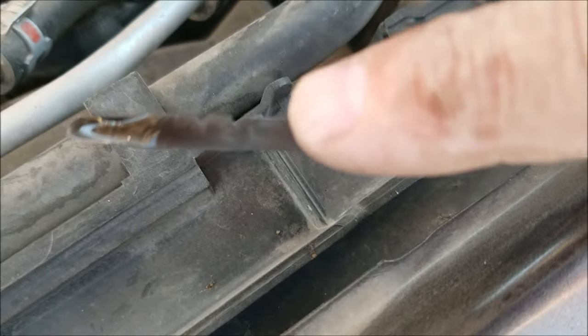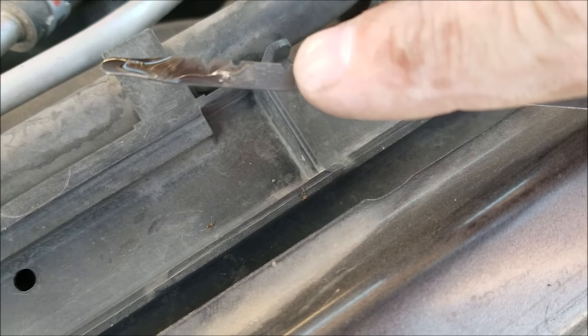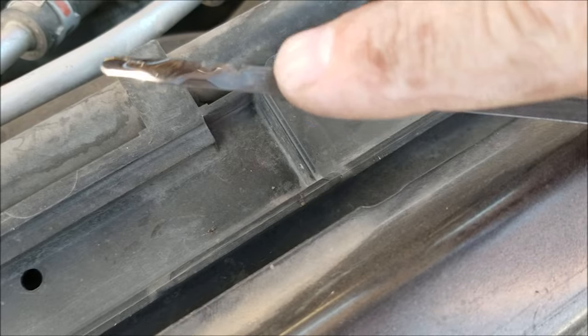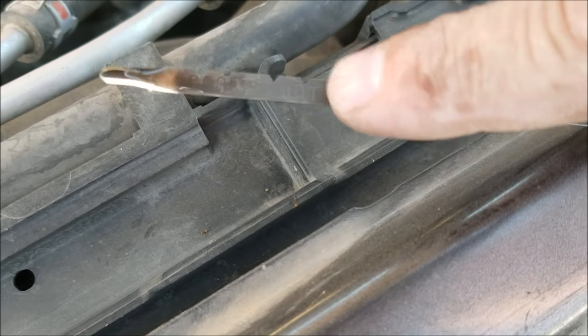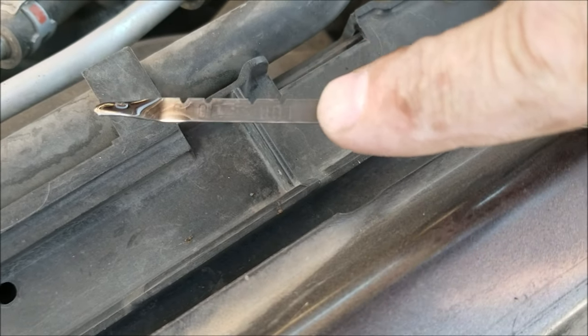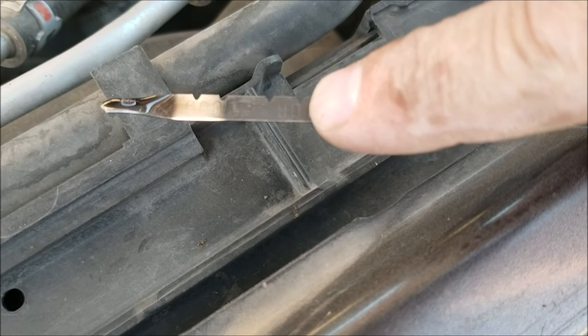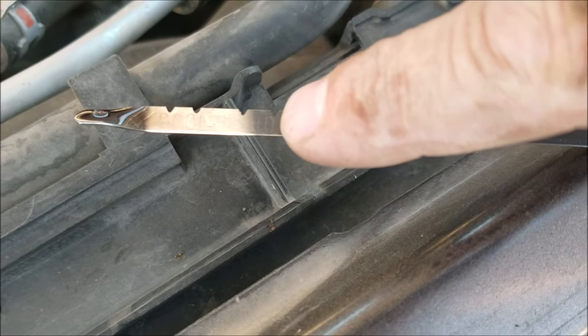Right now this is in the middle. I've been driving it around a little bit, so it should be up where the hot marker is. For me it looks like I'm about half a quart low — I would have to add in a little bit and then check it, then add a little more, because you never want to overfill. It should be up by this line, which might be a quart low, but I'm going to add in half a quart and then check it again.